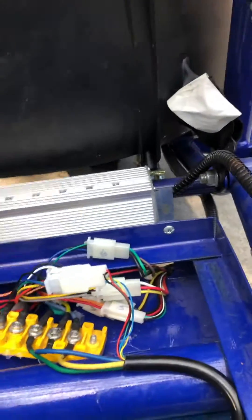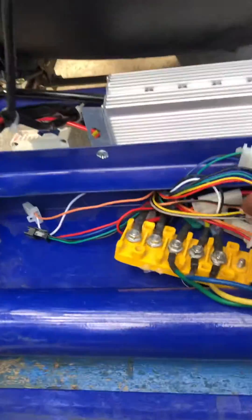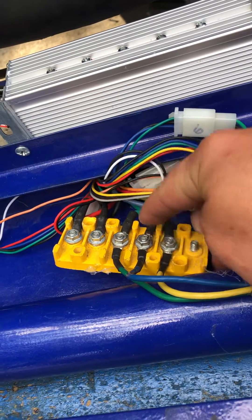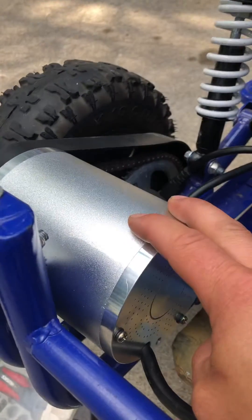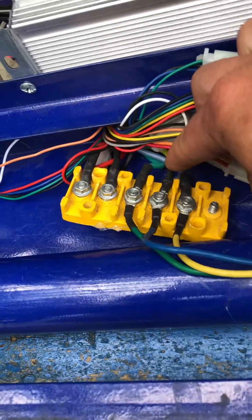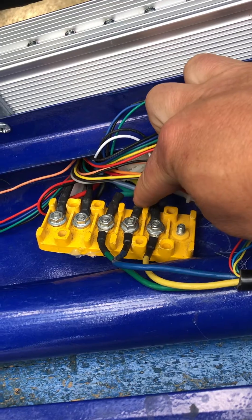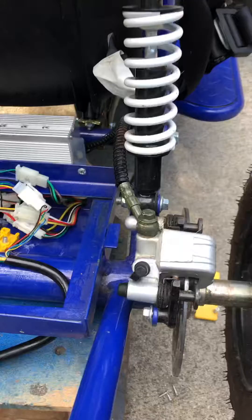So what I did to fix that — this has a three-phase brushless motor. Here's a little bus bar. Originally I had it hooked up yellow to yellow, blue to blue, green to green. A lot of these motors go on MX500 dirt bikes and they're faced the other way, so I needed to make this spin the opposite way. I tried making blue go to yellow and yellow go to blue and green go to green, but the wheels were fighting themselves and it wouldn't go.